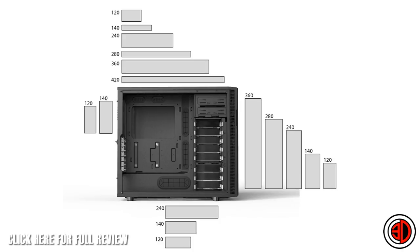I'd personally go for a 240mm radiator in the front because you get that dust filter there too, it leaves room for the power supply, and makes for a tidier loop. A 360mm rad in the roof plus 240mm in the front — you can easily get a full loop done off that: CPU, MOSFETs, chipsets, and a pair of graphics cards including something like two 290Xs, run at near-silent fan speeds. Obviously if you do 240 and 360 options, you'll need to plan hard drive placement and the reservoir and pump — but there are lots of D5 options with tube reservoirs you could bolt to the floor.